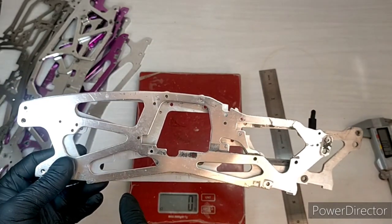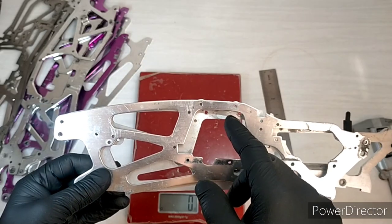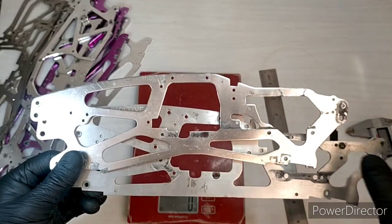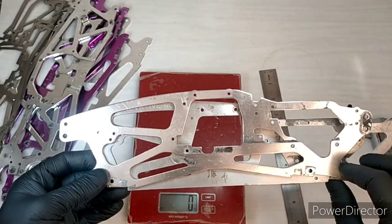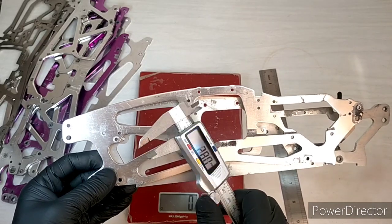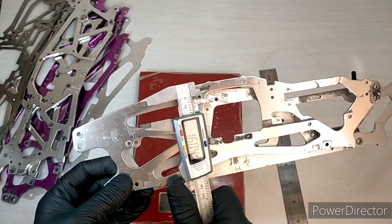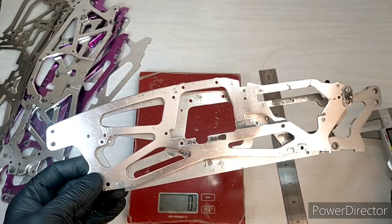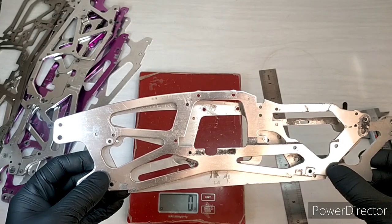Another interesting point is this is what's called a low CG chassis. The central gearbox and bottom half has been flattened out, and you can see it's going to lower the gearbox — maybe 15mm in the design. That does make a big difference to dynamics with that central weight lowered down, and the straighter drive shafts also transmit just that bit more power, not having the resistance of being at an angle.